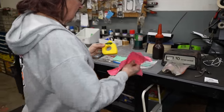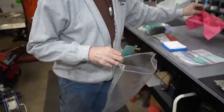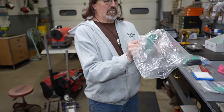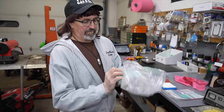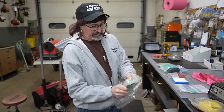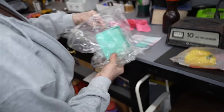It stays nice and clean because you didn't get your dirty hands all over it. So there it is, all pre-oiled and ready to go. If you've got one of these little pre-filters that didn't come in a bag, get yourself a bag, pour some oil in there, and do the same thing. You can see on this one where there are some spots that were missed — throw it back in the bag and pour some more oil in there.